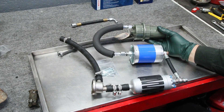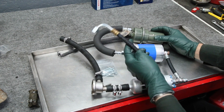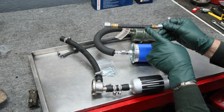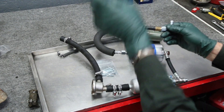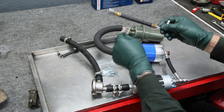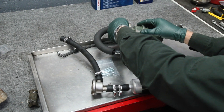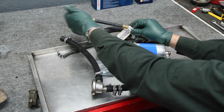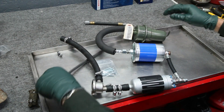You're getting close — one more hose to go. I didn't have the correct hose to shoot this part of the video, but it will be a straight hose. This is the one that's really hard to find: the feed hose from the accumulator to the hard line going up to the engine. It has a fitting on one end, and for the purpose of this video the feed hose goes here as a straight hose, running up to that hard line going off to the engine.